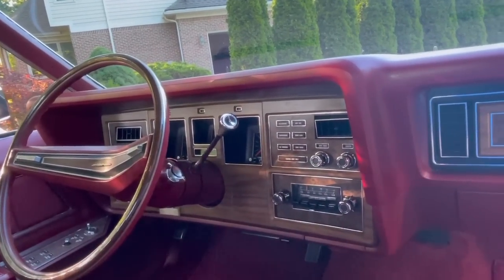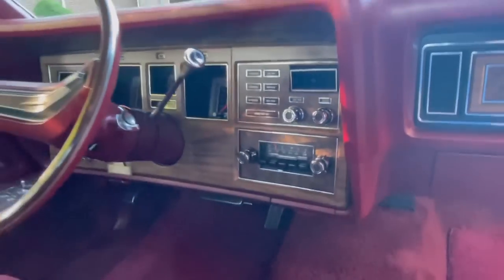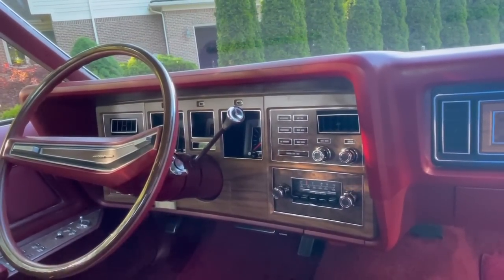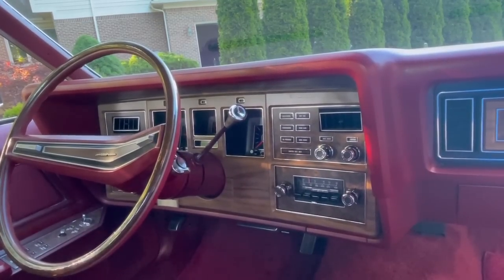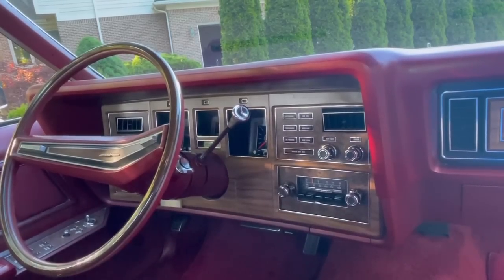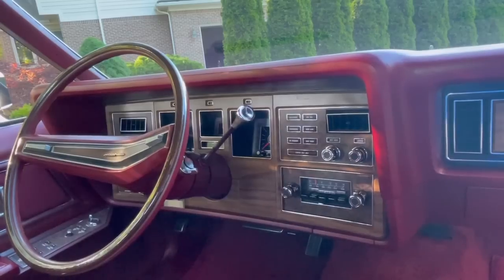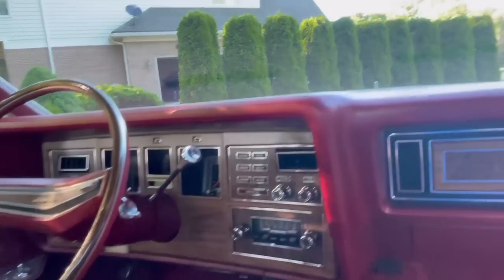This car did have standard, you can see there's a SureTrack light here, standard rear wheel ABS brakes. Yes, that was also a thing of the Continental Mark series, that they had basically an anti-lock braking system for the rear, or a pressure limitation system, to prevent these 5,000 pound barges going sideways across the freeway in an emergency stop. It brakes quite well for its day. I've never had a problem with the brakes. The handling is, shall we say, leisurely, because the car is very ponderous.